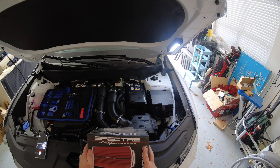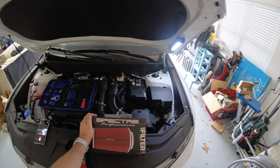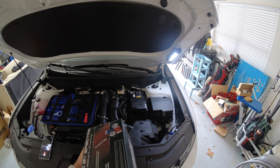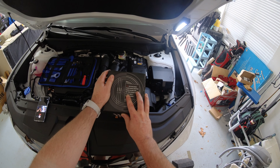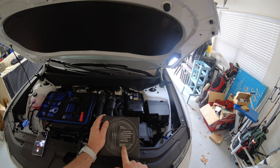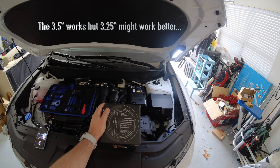Okay everyone, hello, welcome, thank you for watching the video. I am about to install the Spectre Performance — well, I'd call it a Cold Air Intake. Anyone who knows understands that once you take the air box out, it's no longer a true Cold Air Intake. Anybody doing this is doing it for sound, and that's exactly why I'm doing it — to bring out that turbo sound a little more. I got this kit because it comes with several different adapter sizes: three, three and a half, and four inches for intake tubes. From what I understand, the 2022 Santa Cruz has somewhere between a three and three and a half inch intake. Three and a half is supposed to work, but just in case it's a little too loose, I can try the three. Let's go ahead and get to it.